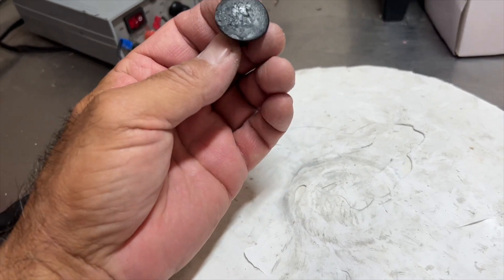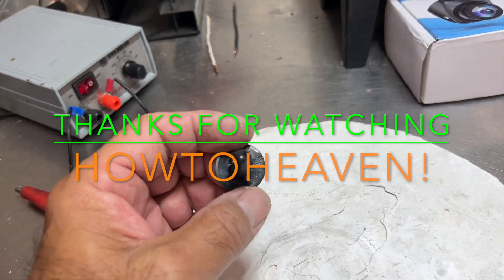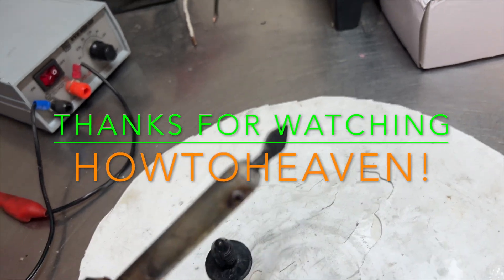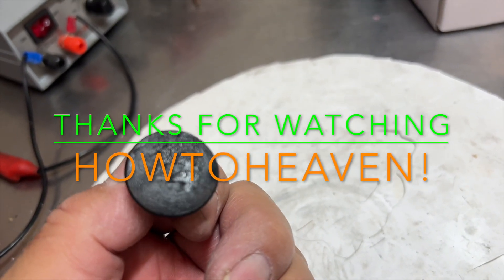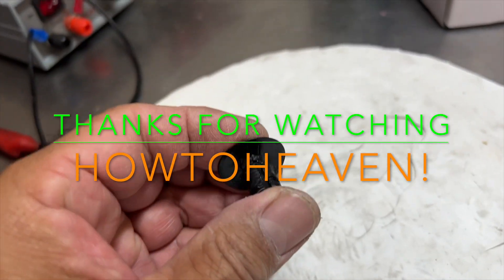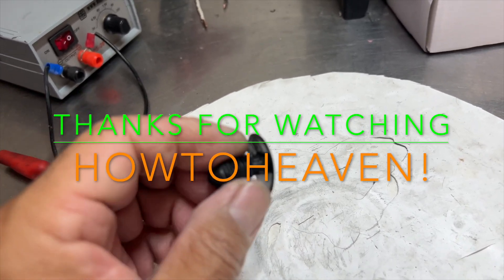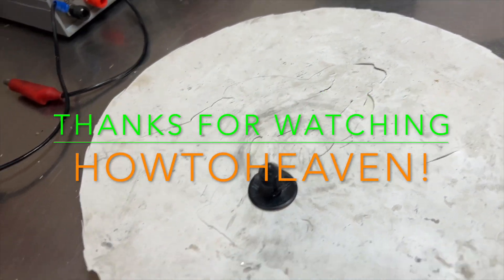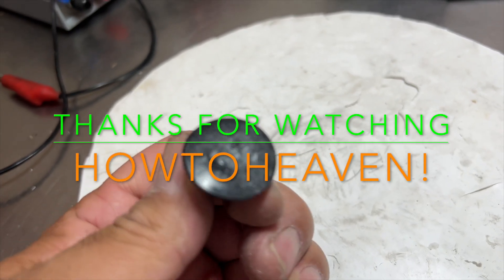Every time I think I'm done with this video there's one more piece to add. This is the retainer that was cracked earlier, and I just wanted to show you that these can be repaired. The way I repaired it: get a standard soldering iron with a spade tip, let it heat up, and then sit here and massage that plastic back and forth — and you'll get it re-fused. These are salvageable if you happen to mess the clip up. That should be strong enough to hold that little retainer in. You can solder — well, actually you're just melting it. They call it welding, but basically you're just melting it. Thanks for watching How To Heaven.